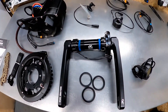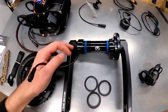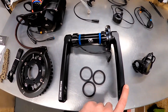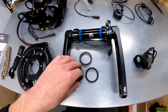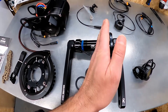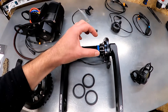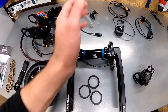The next element is the crank with a built-in torque sensor. Here you can see the cable going out from the sensor inside the housing. You have crank arms and some spacers. Thanks to these spacers it is possible to align the axis and get the proper chainline on the bike — you can slightly adjust the position perpendicular to the plane of the bike.